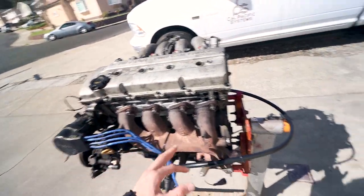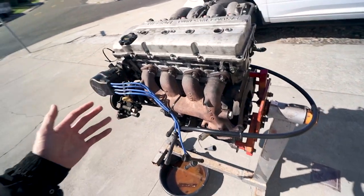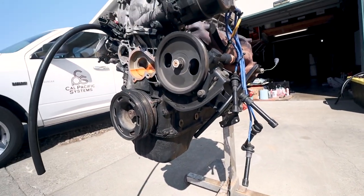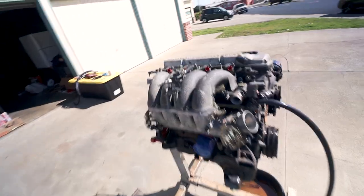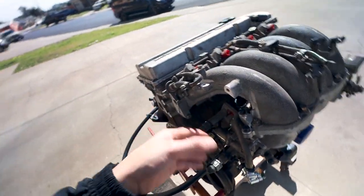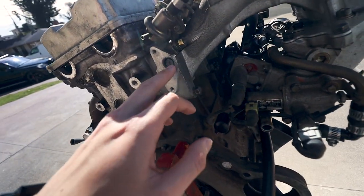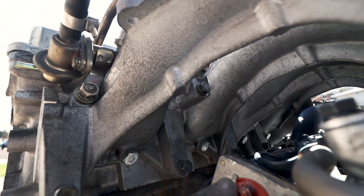For the header side, I have the EGR plug right here. This is for people who want to get familiar with KAs - I know this can be boring to some people but interesting for others. I'm not running AC so I have all of this space and I'm gonna love it in the engine bay - it's gonna be so clean. The intake side is where all the goodies happen - a lot of simplification. Over here should be all your EGR stuff - all that is gone. Right here, the swirl control valve - I tapped it and then JB welded a bolt into there so it won't leak.